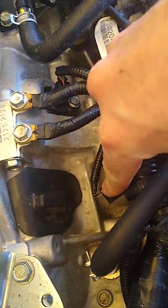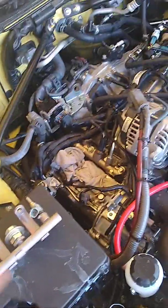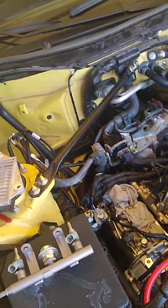I did one of the other ones, runs over here to this one right here, which, I don't know if you can see that. There we go. And that's your coolant temperature sensor. Again, those are the 3 main lines that come out of it, and all of those pinned out just fine. The one issue that I'm running into is running the 5-volt power to the actual pressure sensor to then check whether it's supposed to get 0.5 volts coming out, or 0.5 ohms, or 5 ohms, or 5 volts. The manual is messed up.